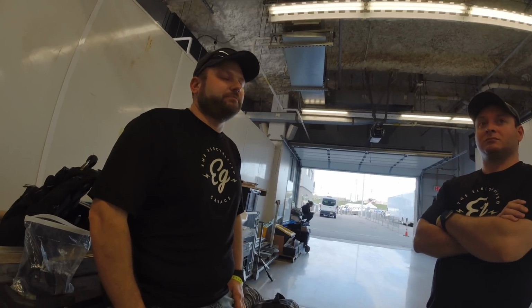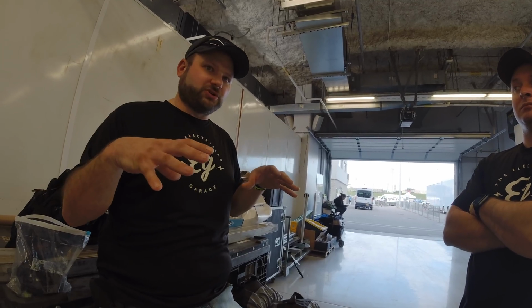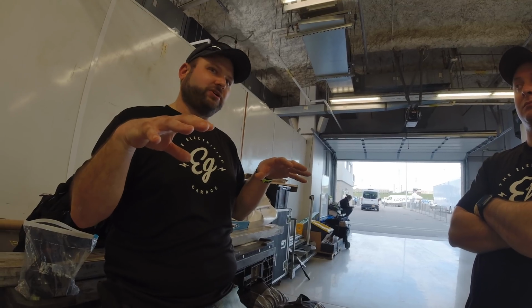And it's not smart enough to be like, oh, if it's cooler, that's fine. It doesn't know, so then it throttles down. It governs itself down. So I think the best way to do it would be to cool the entire cooling system better. You have an auxiliary cooler on it, but keep the rest of the cooling down in temperature. If you can keep the whole system somewhat level, it shouldn't trigger that, because now you don't have an offset. Everything's exactly the same temperature.